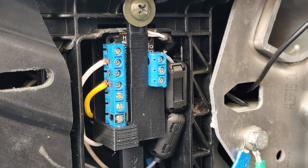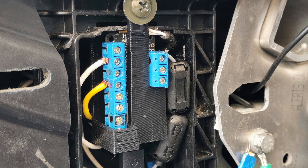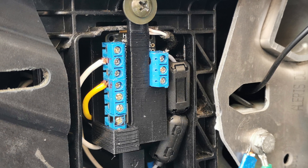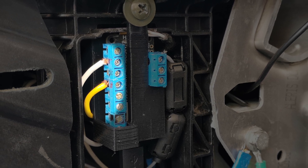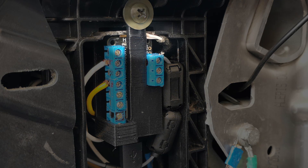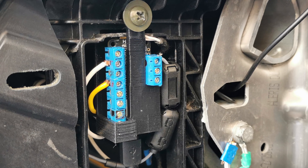The PICO is powered by the USB-C connector with two wires. The ground is attached to the body of the car here, and the 5V positive wire, also the two light control wires — white and yellow at pins 1 and 25 — and also two CAN-BUS wires are all coming from the FRONT SAM.